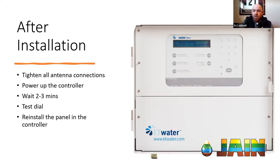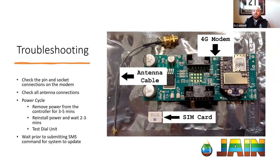One last thing I want to go over: it is technology, and unfortunately technology doesn't work right 100% of the time. There is a chance that after you install your modem it may not make its communication the first time through. Most of the time it's going to be something fixed by one of these very simple checks — going back through and making sure that the modem is installed properly, that all the pins and sockets are lined up and you're not sitting a little bit cockeyed. Also make sure all the antenna connections are good and the antenna is in good shape. If those don't work, then 90% of communications can be fixed by doing a power cycle.